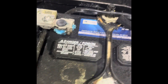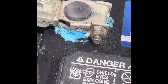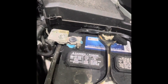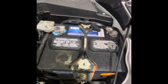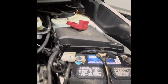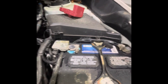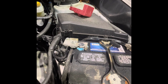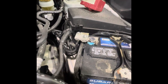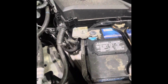This is the start of a bad thing — possible terminal corrosion. The tie-down strap is also starting to corrode. The only treatment for this, because of terminal gassing where the terminal seal is now releasing gases causing corrosion, is to do a battery terminal service using a dielectric-style pad that sits on the bottom of the terminal, preventing those corrosive gases from reaching the actual terminal material.